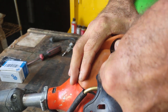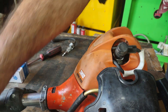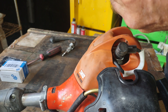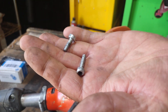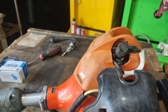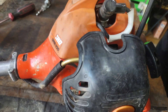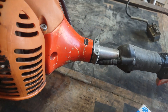Don't make the same mistake — get that cover on. You can see the plug wire goes through here; Echo has always done this. It loops back on itself. Get that cover right where it needs to be with the spark plug down where it is. There's only two screws.